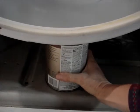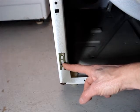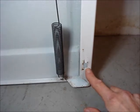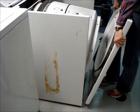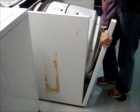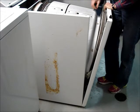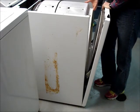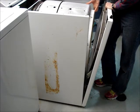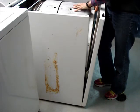Remove the drum support. Reinstall the front panel. There's a hook on either side of the dryer frame, and two holes on the front panel that correspond to the two hooks on the dryer frame. Insert the hooks into the holes of the panel, then push down. Then push the drum backwards and insert the lip sticking out of the panel on top of the inside of the drum.